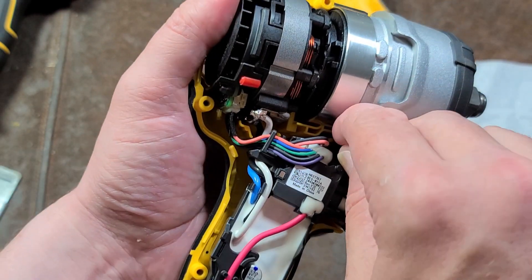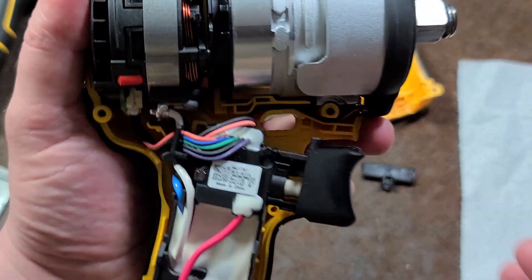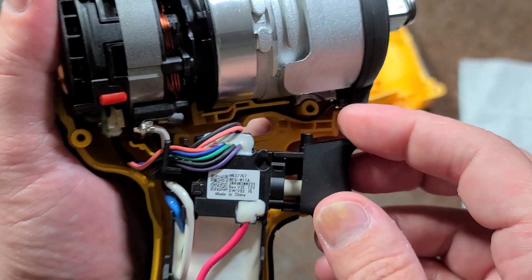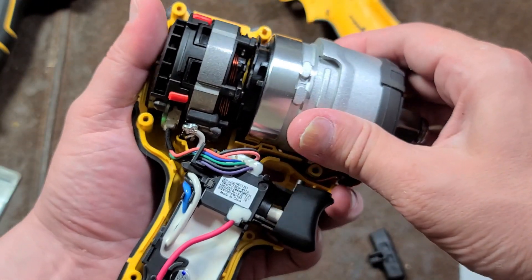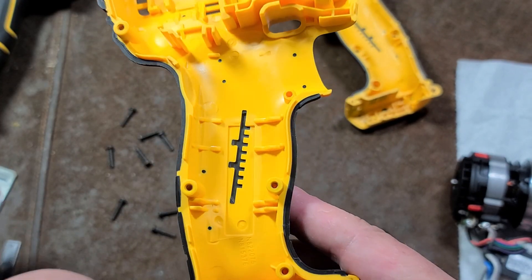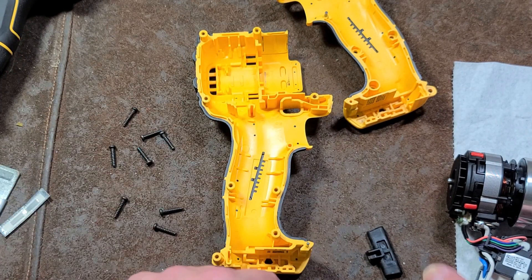Finish pulling this apart. Interestingly, these are essentially assembled in a fixture and then set into the body. There's the reverse switch — make sure that the little center tang gets over the little nub on the switch, because it's really something when you reassemble a tool and realize you got that switch not in the right place. So we'll just pull the whole assembly out. There's the integrated sticker for anti-shoplifting — it's gotten so bad with tools that they didn't even put them on the box; they integrate them inside the actual tool itself.